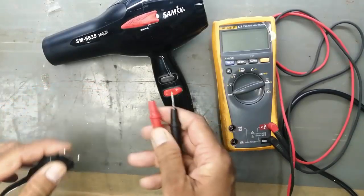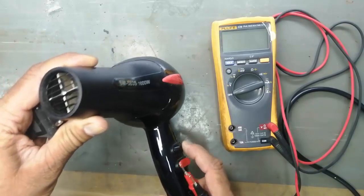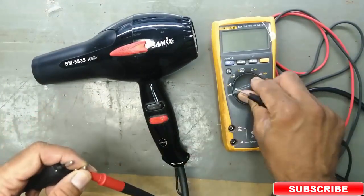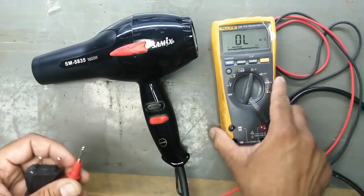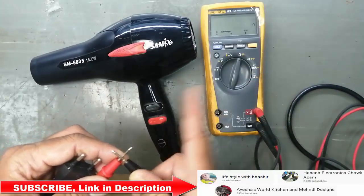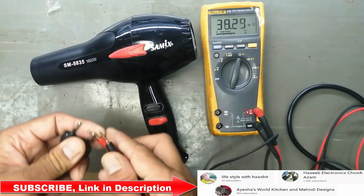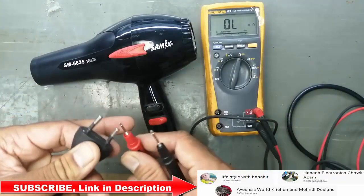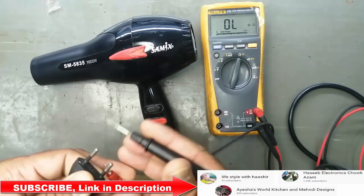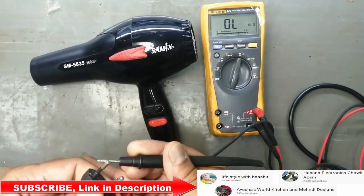I have a Samix hairdryer. It was not working. How I tested: I used a multimeter. To check it, you have to set it at ohm range, check the continuity, check the resistance, connect both leads to the input cable, to the input plug. Now I will switch on and off to different positions and we will check the reading.